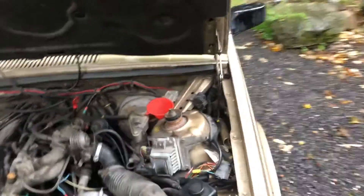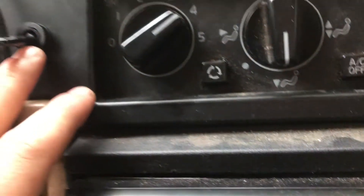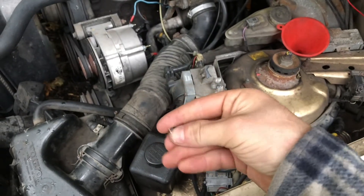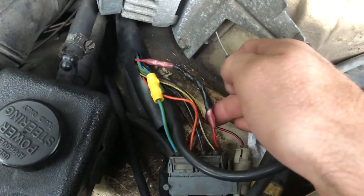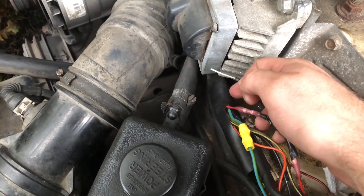I just wanted it fixed, so what I did is I ran a red wire all the way through my firewall — had to drill a hole or two — to a toggle switch, and then back out to a diode, and then to my alternator. My diode is right here. I simply spliced it in with two wire connectors, wrapped it with black tape so it doesn't spark, and then that goes right to my alternator. I reused the original wire because I checked continuity and it was good.